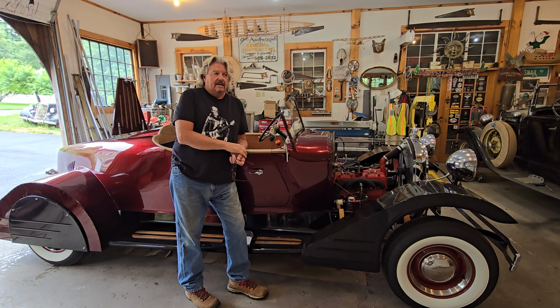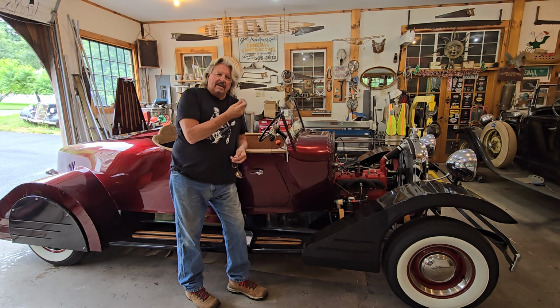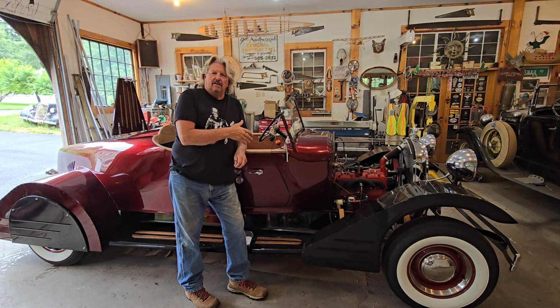If you're fixing something that's leaking, you really have to get in there, grind good, and get every little crease and corner, and I just couldn't get under there. So it held really well, but I can still smell fuel. I don't have anything physically leaking, and when I put my hands on it I can't feel anything, but it's definitely weeping fumes. Everything's wired fine, but if you have any type of spark, I'm afraid of a problem. The last thing you want is to be driving down the road on fire.